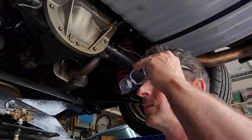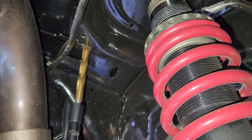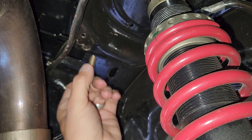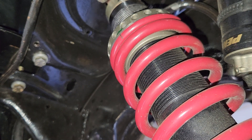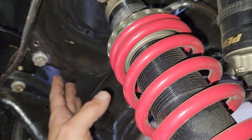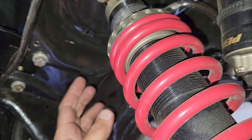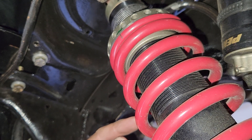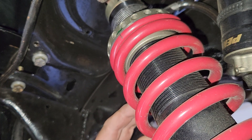That was easy — the bolt fits. Three more to go. Bolts are in. I added washers because I'm a washer snob, but it worked great. Everything clears. I have less than a quarter inch of clearance from my exhaust, so be patient — especially the back bolt on the aft side on both sides requires a one-finger trick getting the washer and nut on there. Tighten those to 25 foot-pounds and we're good. Now I've got to get this off the lift, probably go around the block a few times to let the suspension settle, and then test our reading on the back part of the frame.